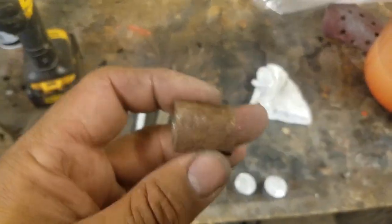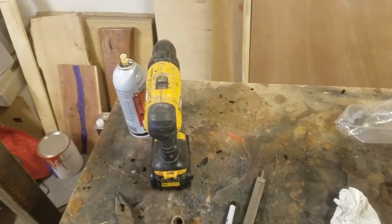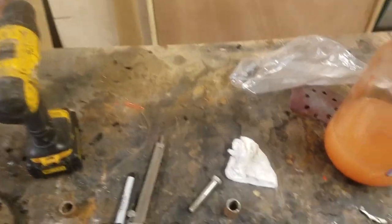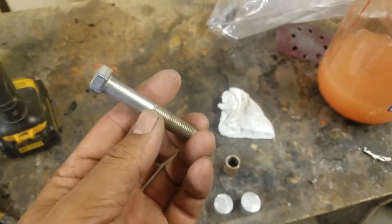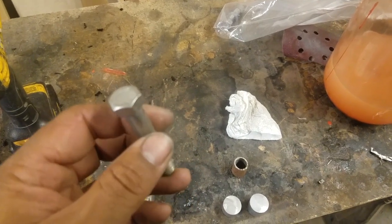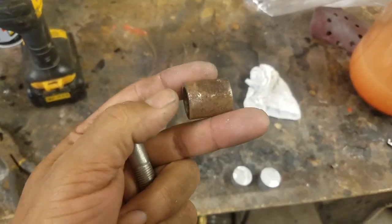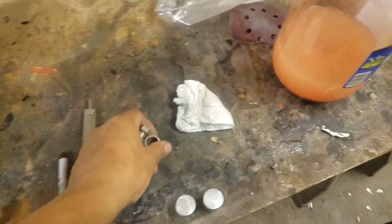And you need these spacers because the top bar, what they call the C-pillar bar, is mounted where the rear seat belts are usually mounted. And this bolt goes in there. And then, of course, the plastic trim that goes on that C-pillar has a space in between the plastic trim and the actual mounting area. So you have to put this on there, and then there's a bracket that goes up here that's bolted onto it, and that's how the C-pillar is mounted.